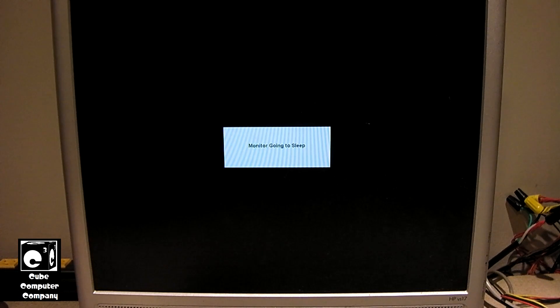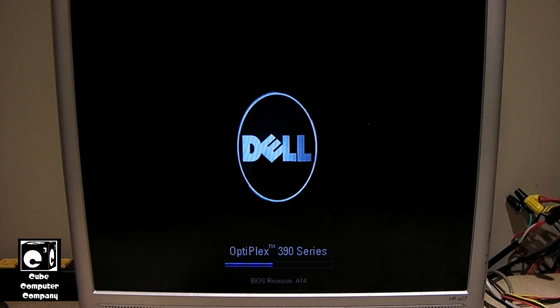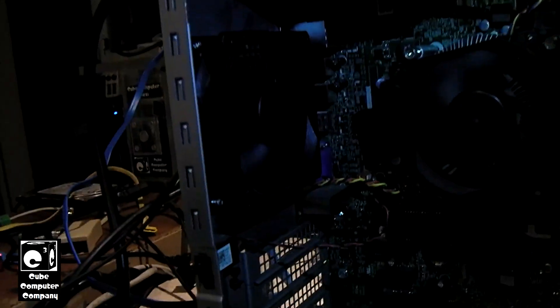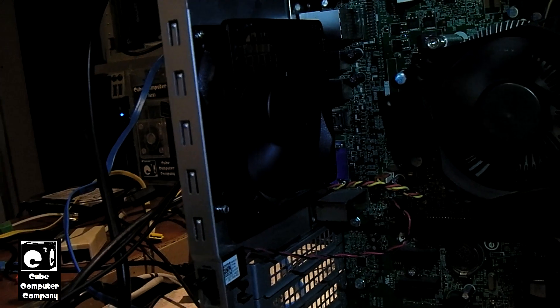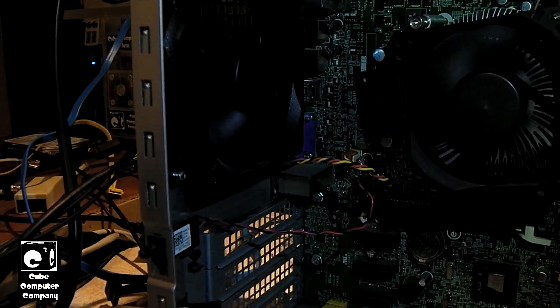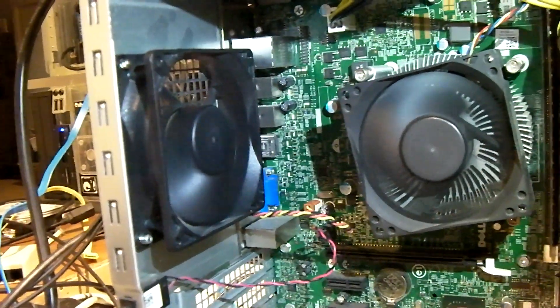There's no OS on this machine right now. That cleared the fan message. So there you have it — you just have to lube the fan up. If you have some fan screws kicking around, great; if not, you can deal with those grommets — I don't really have the patience for them. But that's how you can resolve that fan failure message.